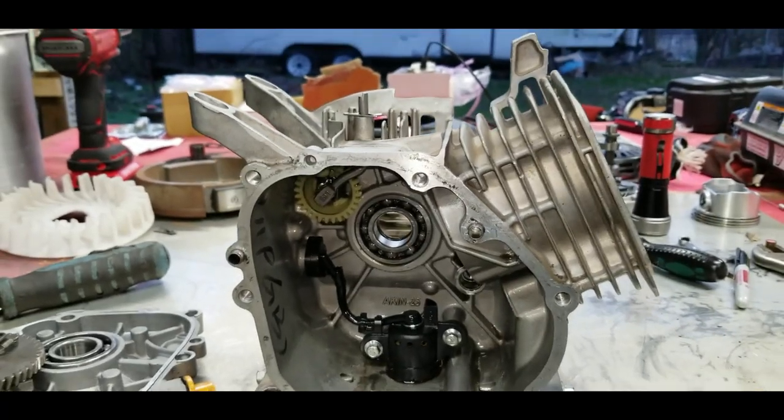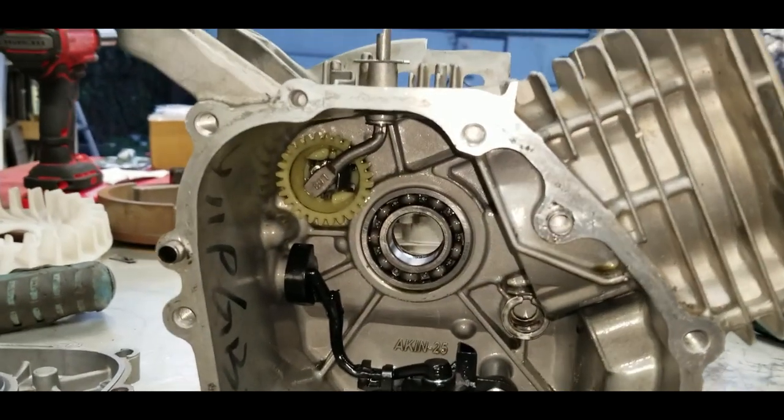Now I'm gonna get that stuff cleaned off the crankshaft there. We'll go ahead and get the crank back in the block, get our camshaft installed as well, get all that stuff torqued down, get that side cover bolted back up, and we'll get ready to put the head on. Actually, you know what, before I do all that real quick, I'm gonna go ahead and show you. I'm going to remove the governor out of this thing as well. And if you've never removed a governor from one of these engines, basically